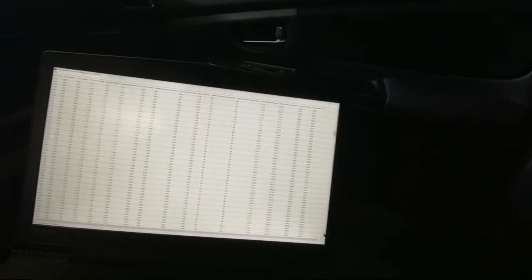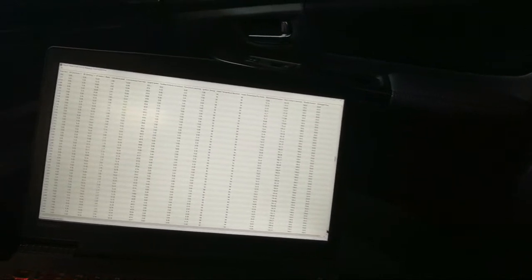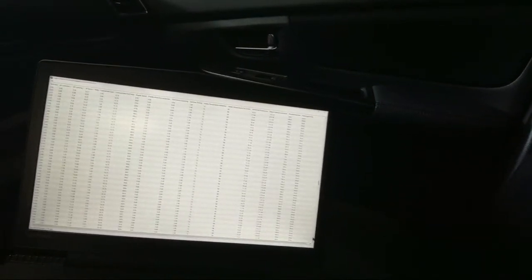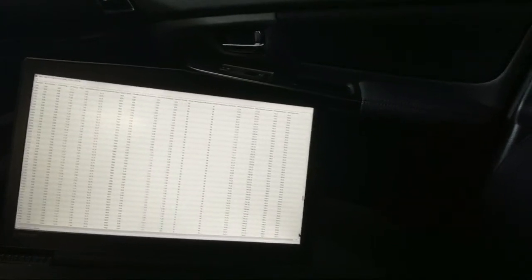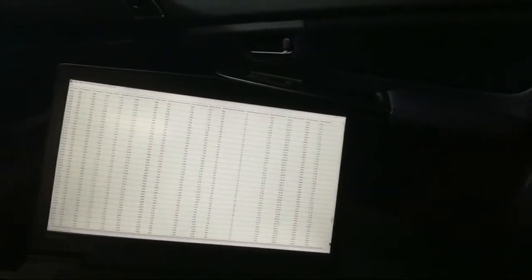This is taking a long time. Let me skip forward some. All right, here we go, pull starting now. They're even. We're at 45 and the manifold is starting to warm up. We're at 5,000. Now it's above pre-turbo temperature. And we're at 6,000 almost. Here's 6,000. Now we're at 90. So from 60 to 90, that's actually not too bad. But these sensors aren't instantaneous, so there is some lag time. And usually what you'll see is that after the pull, it continues to increase. 62, we're at 95. Now we're at 100 by 65, 104. All right, so the end of the pull happened.